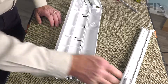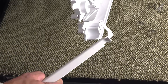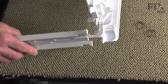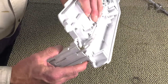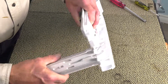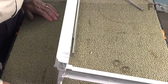Now we're ready to put the air adjustment portion on. We'll start by lining up that slotted tab and the slotted opening on the actuator arm. Make sure it's engaged and pivot it around. Then by flexing that plastic piece, we're simply going to clip it into the back. Make sure it's properly engaged. Now we're ready to put that assembly back in the refrigerator.